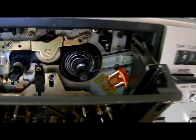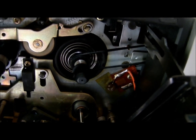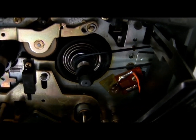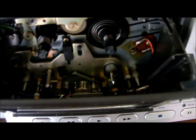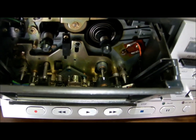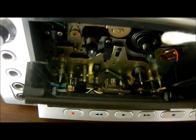I have changed all the belts — you can see the one there going up to the tape counter, which has picked up some of the black gooey rubber from the old belts. There was a problem trying to clean the belt path from the old terrible melted rubber. Whilst I've got access to the mechanism, I've cleaned the two heads — well, it's a three-headed deck — with a little cotton bud with some isopropyl alcohol. You can see it's picked up a little bit of debris there.